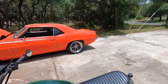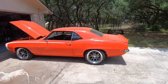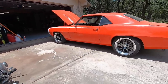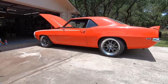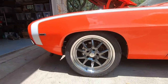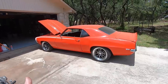The only time we got the car to scrape was under that really heavy bump — probably going 50–55 miles an hour into a little creek crossing dip. If that's the only time the car rubs compared to what it had before, that is a massive improvement. I also don't think we've hurt the looks at all — if anything I think we may have improved it. Now it's kind of perfectly level: the stance before had the back end a little bit lower than the front. Looking at both front and rear tires, we can almost see the top of the tire but not quite — nice level stance. I still have some adjustability should I decide to use it, but I think we're ready to move on to continuing to tune this thing.